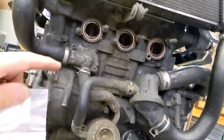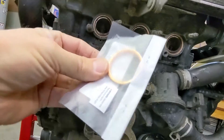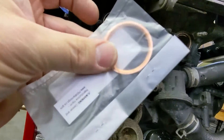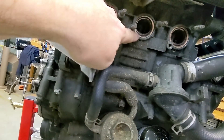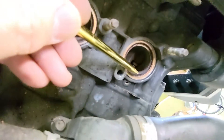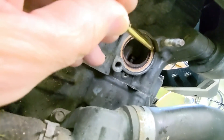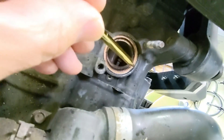If you look up in here, those are the exhaust gaskets, and I've got new ones right here. These actually crush when you put it back together, because when you tighten it down it's mismatched — you can see the mismatch if I zoom in right here. This surface area all the way around — that's the gasket, it smashes down.